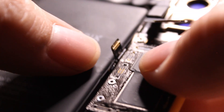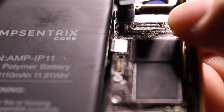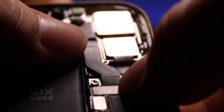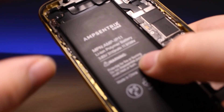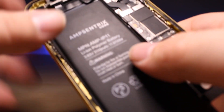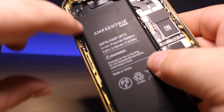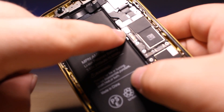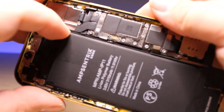The Tag-On slides down right in between the battery — should be able to line it up nicely and click it in. We can reconnect and put back the rear camera assembly. I'm running into a physical gap issue — I need to make it a little bit bigger. This battery has been replaced before, so I should be able to put a little bit of isopropyl alcohol under it and slide it over. If that's not the case, you'll have to pull the tabs out to slide the battery over to the other side so that it leaves enough clearance — that would actually make the Tag-On flex fit even better. Let's take some isopropyl alcohol and get that battery to slide. Now I can move that out of the way — now we've got plenty of room.